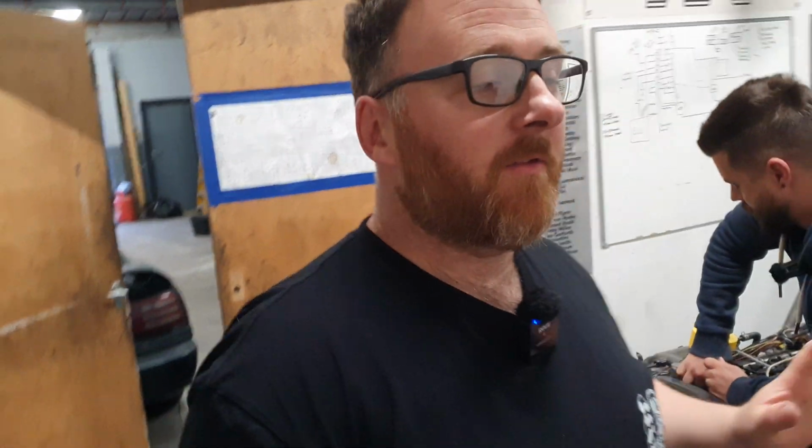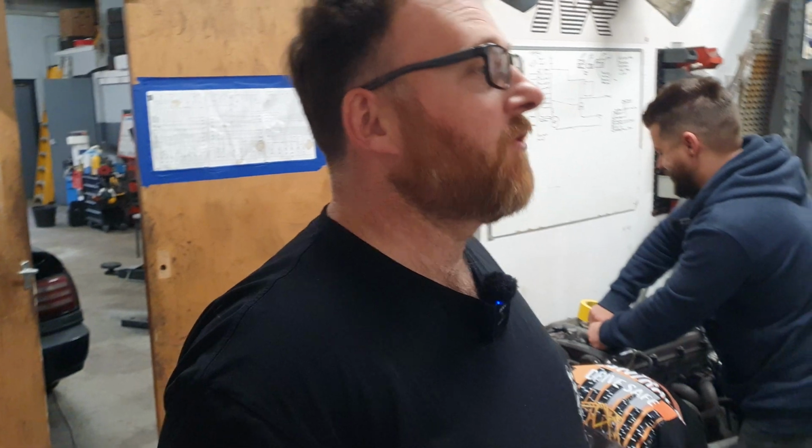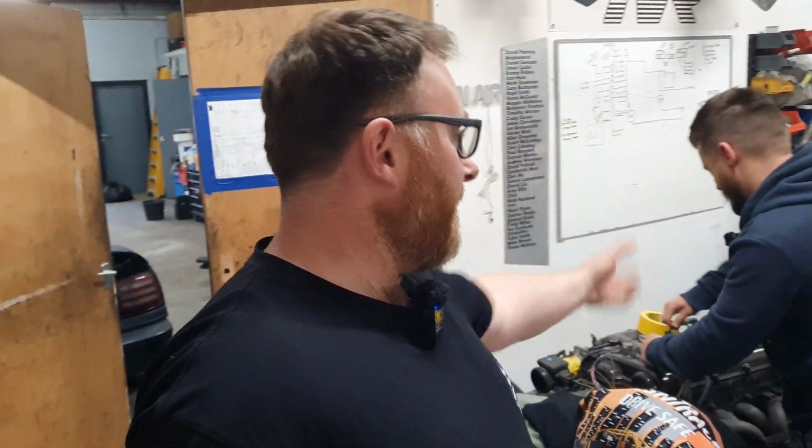So I'm going to be honest, we have skipped a few steps here, mostly to hide my absolute stupidity, because the first thing we checked was, why didn't we get a spark? Now I'm going to skip forward a few steps again. I've bought an ME221 because I was so frustrated with having to deal with the immobiliser issues, I just wanted it deleted. You buy an aftermarket ECU, it doesn't support an immobiliser, so therefore it will disable it, which is a good thing, it's something I wanted. So plug that in, still no spark.